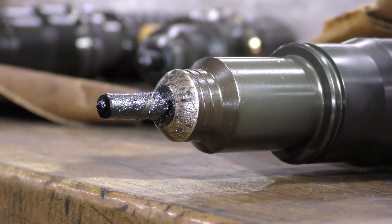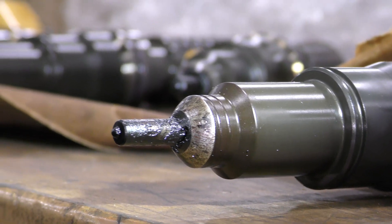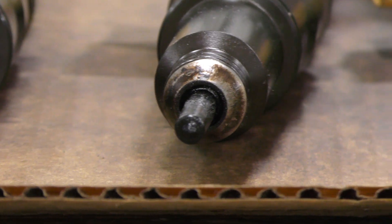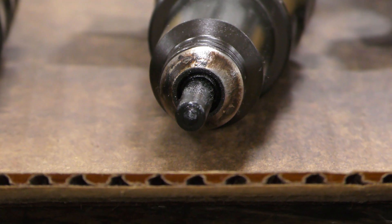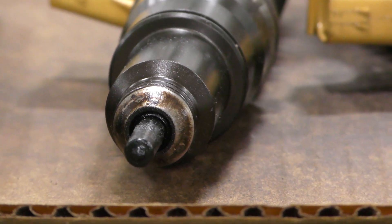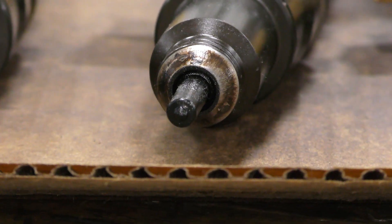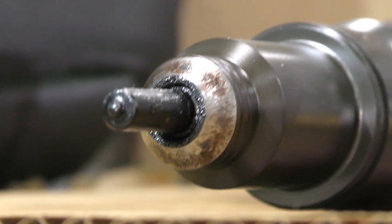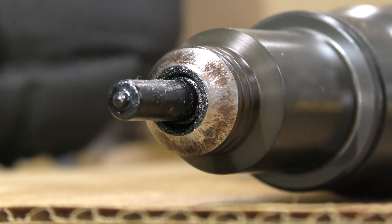The lack of a sealing band on the tapered section of the injector indicates that this injector has been sliding up and down in the cup. Injectors that look like this would allow combustion gases to leak up inside of the cup and directly aerate the fuel system, which in turn would cause poor performance. While this would be considered general broad wear, fuel in the cooling system would not be indicative of injectors that have failed in this manner. Instead, that is probably an injector cup O-ring that has failed, allowing fuel and coolant to mix.